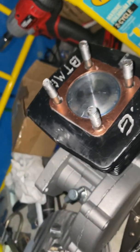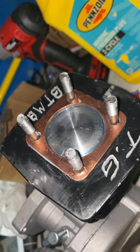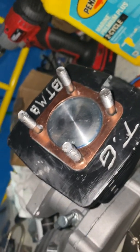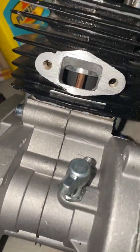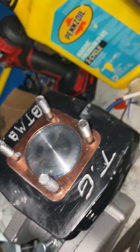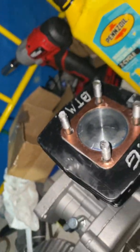Using a copperhead gasket — it's got a gasket plus Yamabond, it'll never leak. SKF 6202 bearings in this one. It's gonna be a runner, made to run for a long time. No vibrations, no horrible vibrations, because I have no piston window — just a third transfer up under the intake. Takes the plate, still does the job.